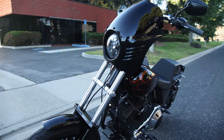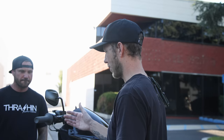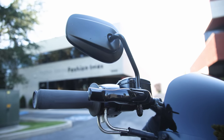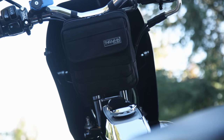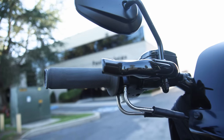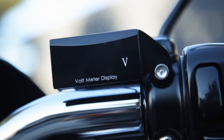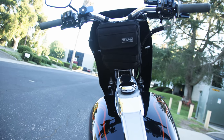Everybody knows that when you have a fairing and take it off it feels lighter and more nimble — that's the feel I was going for. I also notice these look like shorty levers you made — I put my fingers on them at the bend, marked them, cut with a Sawzall, cleaned them with a grinder, and powder-coated them. Two-finger levers. These are all late-model switch housings; the FXR would have the square ones but I wired these in because I like the more round updated look, off a Dyna. Also a Brembo bagger front brake master. That's a volt gauge — the only time I've ever been stranded is when the charging system takes a crap. I made this gauge mount so I can watch my charging system on the road: if it overcharges I unplug the stator, if it undercharges I pull over and swap the battery.